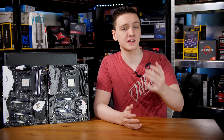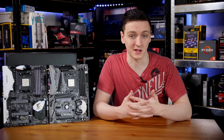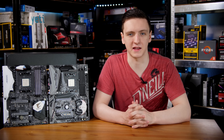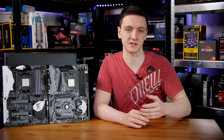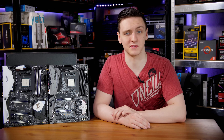It's something to bear in mind, and as motherboards get discontinued you may find that 3000 series chips won't work on X370 purely because the motherboard vendors have stopped supporting them and giving them BIOS updates. So just be aware of that if you're planning on upgrading to Ryzen 3000 or 4000 series chips while still using an X370 board.